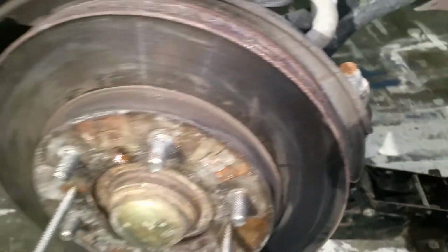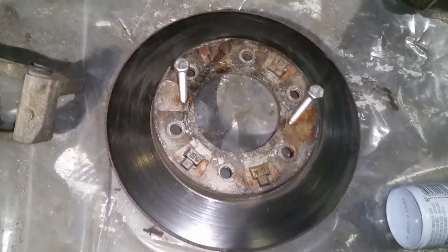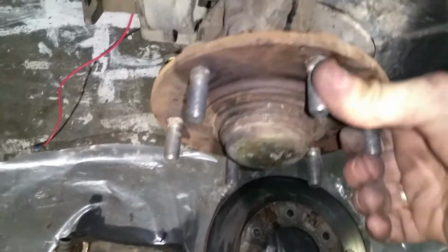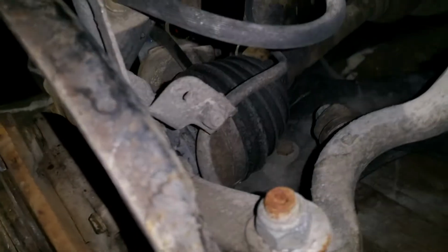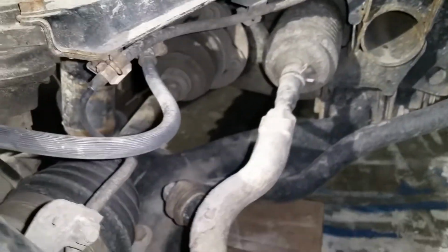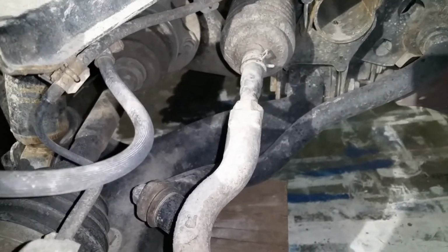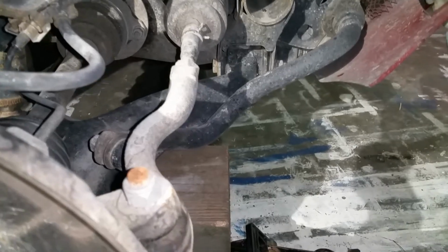And while I'm here, I'm going to take the rotor out. I inspected both sides of the rotors, both braking surfaces, and inspecting and cleaning this area. And you can turn this one by hand, and you can inspect the CV shaft, the boots, make sure everything is intact, nothing is leaky. So if you see leaky boots anywhere, you make sure you go to a mechanic or buy a set and replace it by yourself. For emergency you can insert some grease, but that's for another video maybe.